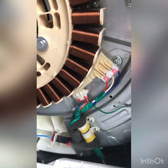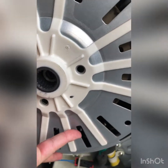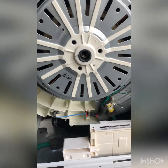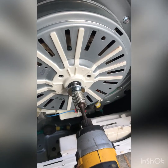Now we're going to reconnect our two wiring harnesses right down here. With our two harnesses back installed, we're going to put our rotor back on — it's going to just slide over the shaft like so, just give it a wiggle. Then we're going to add in our 19 millimeter bolt right to the middle and tighten it up.